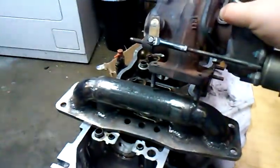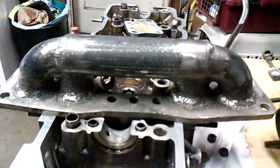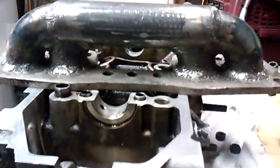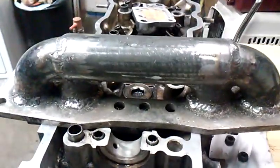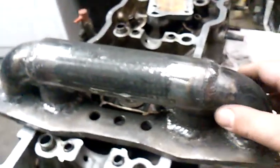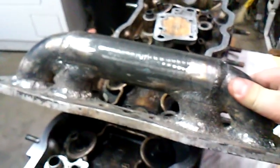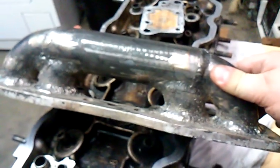My Garrett T3 will mount on there, and once the plate's on, it'll look all nice. That's the header for my 22R, made out of some cheap pipe from the metal shop and my flange. It's not that hard to make these yourself — you just gotta have some motivation. My motivation is because I just want to build a really kick-ass truck.